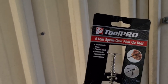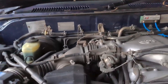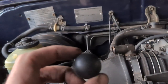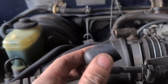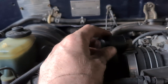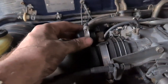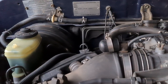This is the best $7.50 you'll spend in your entire life — the 61 centimetre spring claw pickup tool. Also, I've got a vacuum leak here where the old gas system used to feed into the air intake. I've bought a rubber bung for four dollars from the radiator aisle at Super Cheap Auto. You just whack it on and then clamp it with a hose clamp — mine's too big, so get a smaller one, but that's exactly how you fix it.